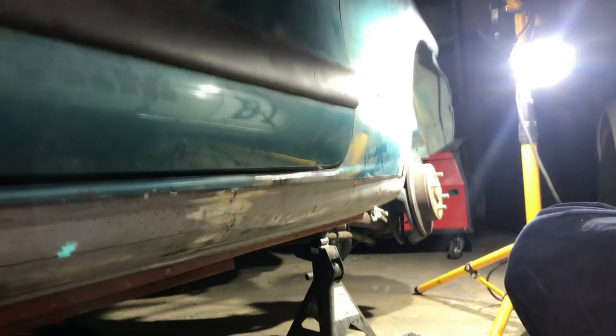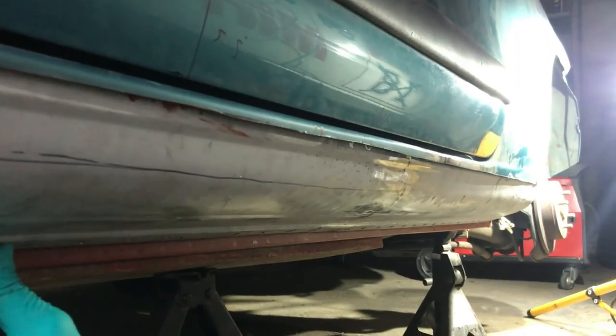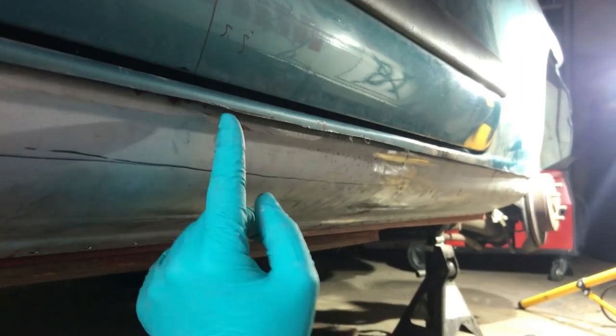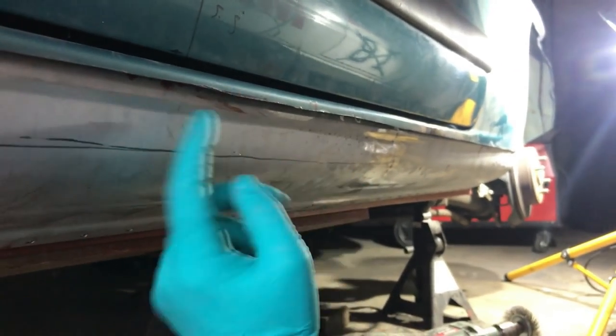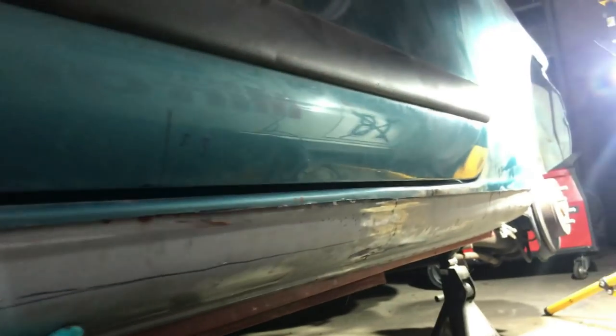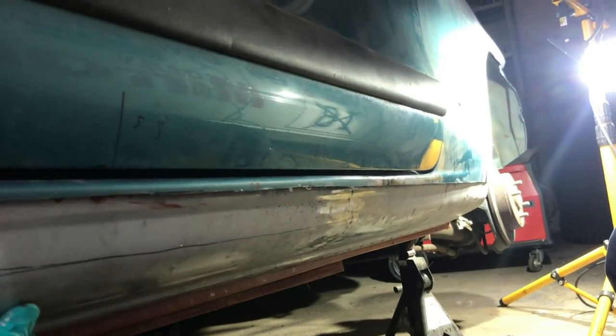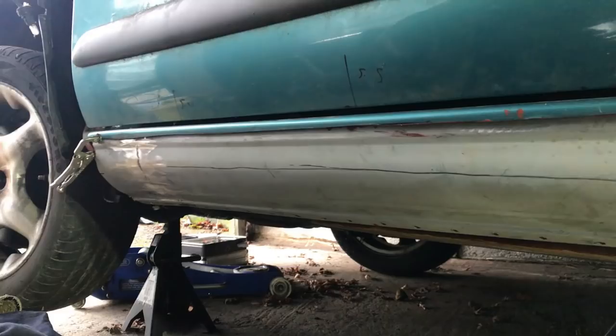Progress is at least being made but it's painfully slow, because now I might have bent it too much. It's really nice at the rear - nice and straight. It's a lot nicer repair than had I just done little sections. But I've got to now pull this out so it butts up nicely against that flange and then I can weld it. To do that I'll either need to use self tappers or Clico pins again, and that's going to take ages and be really frustrating to align the holes on the outside with the inside.